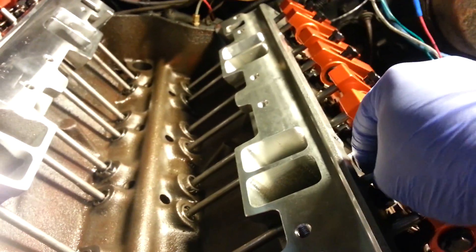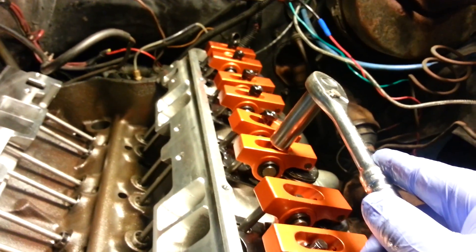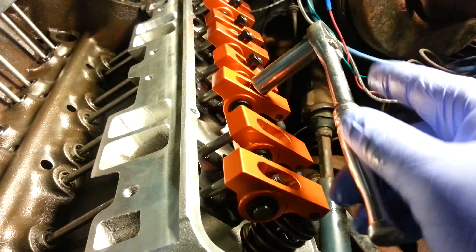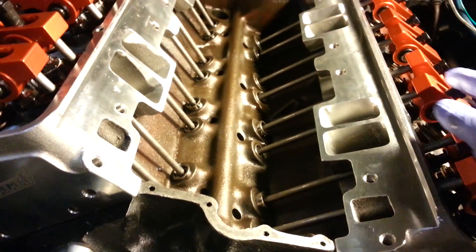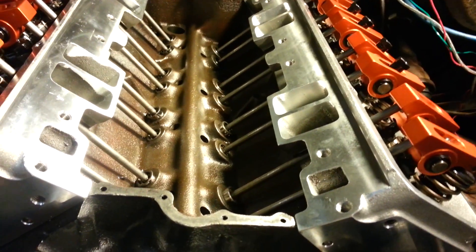You can kind of jiggle it — that means you're at zero lash. Some guys want to feel a little snugness, like it's hard to turn. Some guys call that zero lash. At that point you're going to take your ratchet, put it on, and then turn it in the sequence you choose to tighten it down — whether that's a half turn, a quarter turn, a three-quarter turn, or a full turn. I do a little over half. So on number three, the exhaust is opening so I would set this intake — and the intake would be set. Now the exhaust is going to close, the intake is going to open, and as the intake closes then we set the exhaust — we'll watch that movement next.